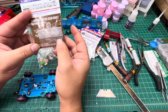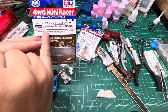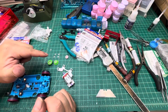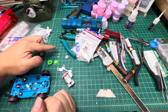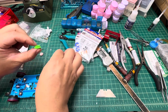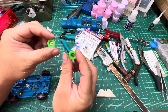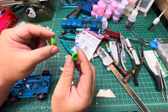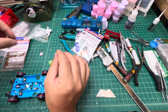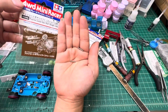First, make sure you do not use the stock counter gear shaft. Use the upgrade one, which is item number 15390 — the fluorine-coated gear shaft. When you open the package, it comes with four roller spacers and a pair of counter gears, custom modified with two AO520 bearings on each gear.